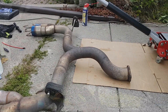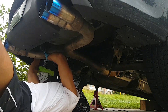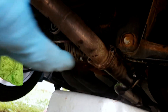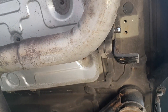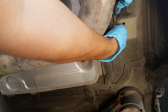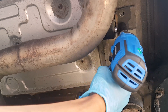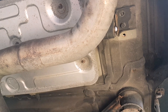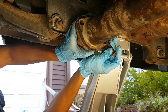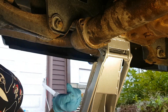For the axle back, one side will be supported by the jack and the other by my hand. Mount these two hangers up and that's it. Because I'm having a hard time aligning the mid pipe, I'm going to have a single fastener bolted on offset on each side. Make sure that's super tight — that cannot come off. Now I'm going to put in my new gasket and the 14 millimeter bolts and that's it.